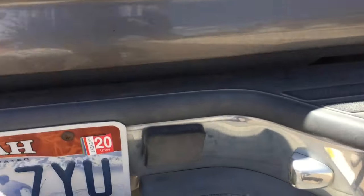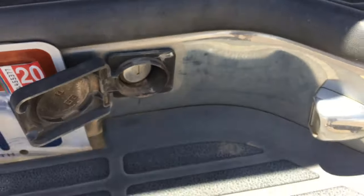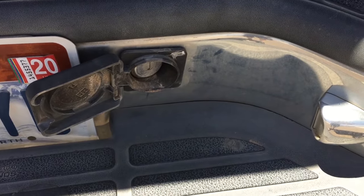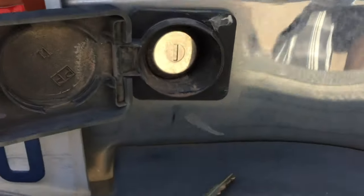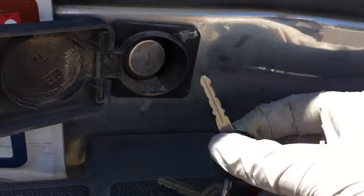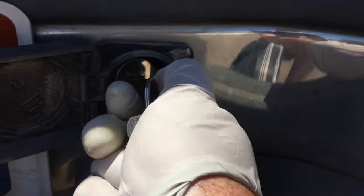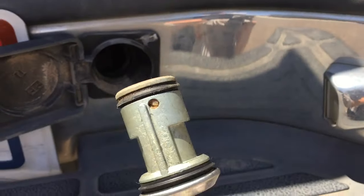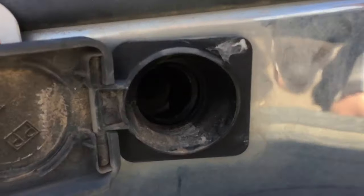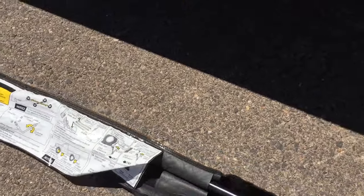Next, you're going to look for the little door here. As you open it up, you'll see a little lock, so you're going to need the key from your vehicle. If you have a key fob on a newer one, you push a little button and it will pop out. Basically, you're just taking your key, putting it in here and turning it — it's going to unlock it and you can pull this cylinder out. Now, these rust all the time, so you might want to just remove it while you can and throw it away. No one's really going to steal your spare tire.